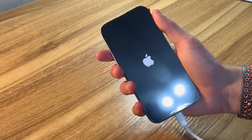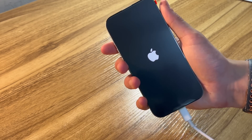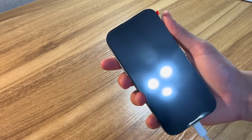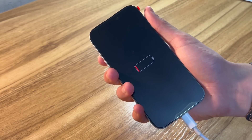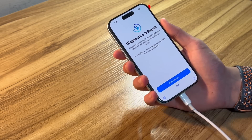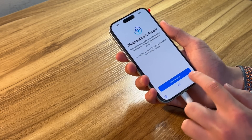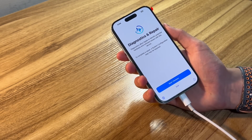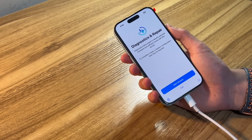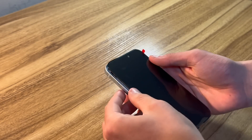As soon as I connected a MacBook Pro charger, the iPhone started to turn on. It immediately booted into the diagnostics menu, but the battery immediately died - looks like she needs some time to charge. After getting enough power, I realized this is the iOS 18 finish repair system - that answers one question about whether it was running iOS 18. I have touch working. I'm going to go ahead and put the camera and back glass on, clamp it down, and try to finish the repair through the software. I'll shut down the phone and clamp the screen into place.